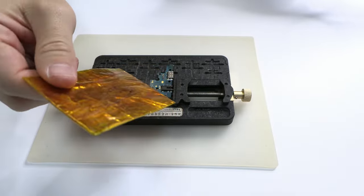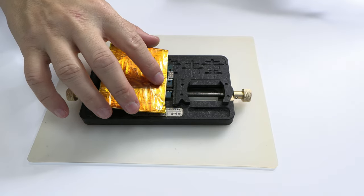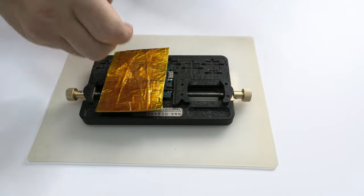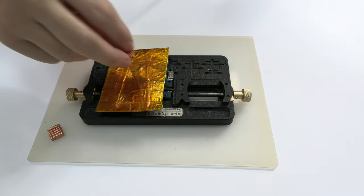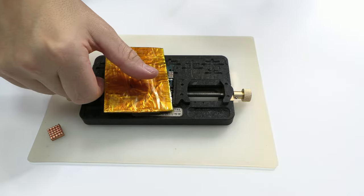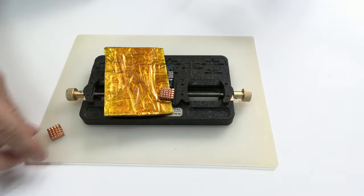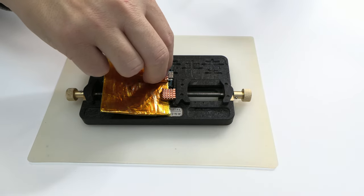Since we cannot regulate the volume of air of the hot air gun, it's better to protect the components. If I were to use a hot air station, I wouldn't protect anything. To protect the components, we use a plastic card with double Kapton tape atop. We let the heat escape on the back of the plastic card.